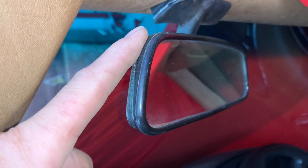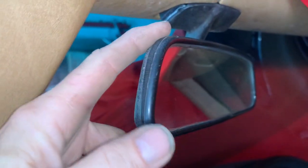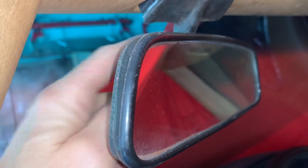To get this mirror off is actually counter-intuitive and not something you would think of unless you've seen it done before. It's basically held on by a spring, and to get it off you have to grab hold of the back stalk and spin or twist it, then pull as hard as you can - eventually it'll come off. Try not to pull it by the mirror because you're more likely to pull the mirror section off. You'd need to take the mirror off to remove these trim pieces, as there are three screws underneath.